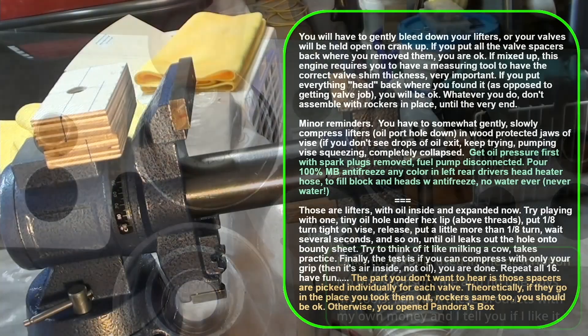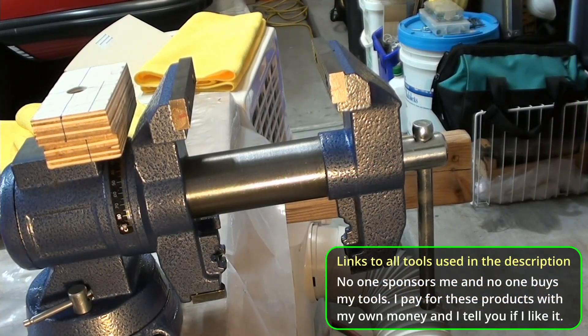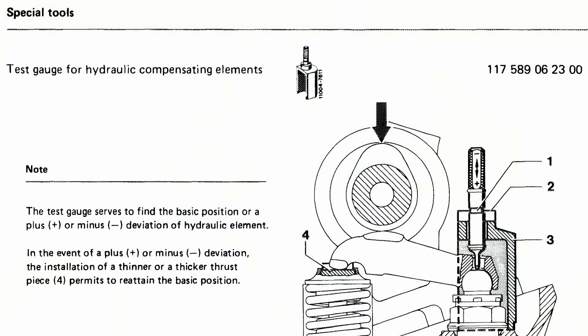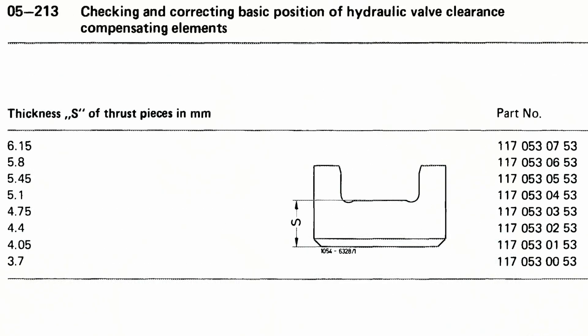For the first time I actually purchased a vise — I never had one before. I always wanted one but they're super expensive and I'm hoping this isn't a junk one. I also mentioned in a previous video about having to check the valve assembly distance if you mess with these things — it's not about the lifter itself, but the whole valve assembly. I might have to buy that tool to check, because I bought new valves. You adjust that height by buying a different thrust washer, so as long as you didn't send it out to a shop you should be okay.